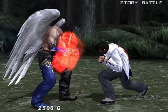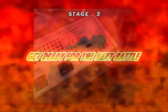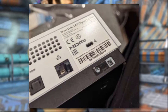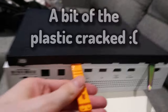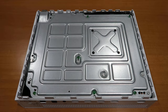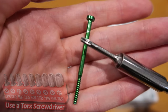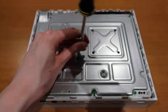You're probably wondering how I got the hard drive out, so let me show you. The first thing you want to do is make sure your Xbox is turned off and disconnected from all cables and wires. Turn it around and you'll see a small Xbox sticker — I would recommend peeling it off because we need to take the base plate off. Getting this base plate off was so frustrating. You're probably better off using one of those Lego separator tools if you have one. I've seen people use screwdrivers but I wouldn't recommend that — you can crack it easily. Once you get it off, take out all of the green screws. They're pretty long; you mainly just unscrew the bottom bit then pull them out.